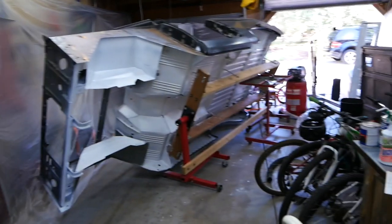All right, day two. I cut it short on day one because of two reasons. Number one, don't use a 1.8 tip with epoxy. My error, thinking that it was a primer and we needed to use a 1.8 tip for primer, but epoxy is super thin.